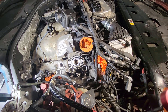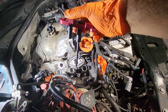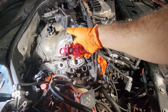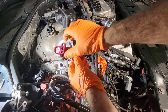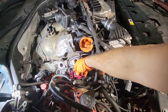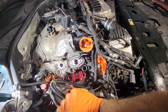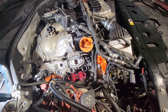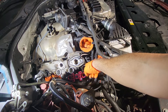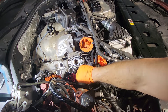First we need to make sure the tool is aligned so that the bolt intended to attach to the fuel line bolt hole is aligned properly. As you can see it is not aligned, so I'm going to use my Allen wrench to remove this bracket, swap them out, and make sure the tool sits right on top of the bolt when aligned. This orientation is applicable to this right bank — when you try to remove the injectors on the left bank it's going to be a little different and you'll need to align it accordingly.